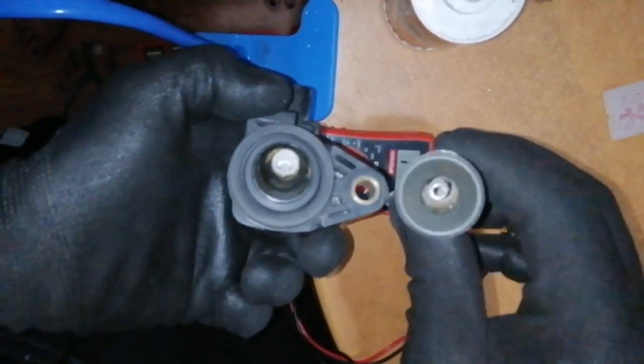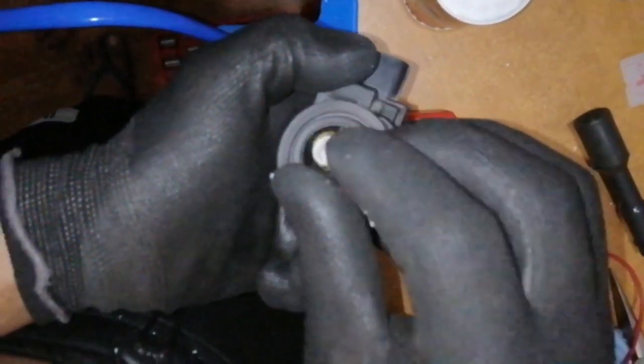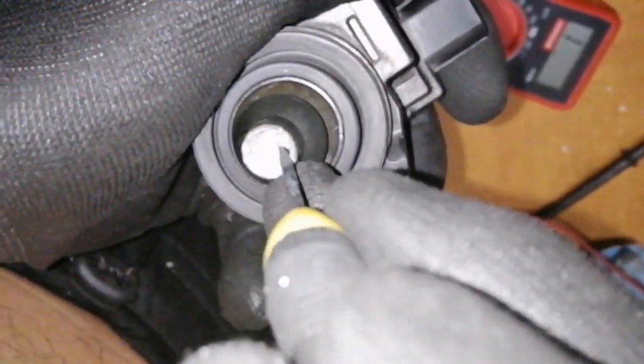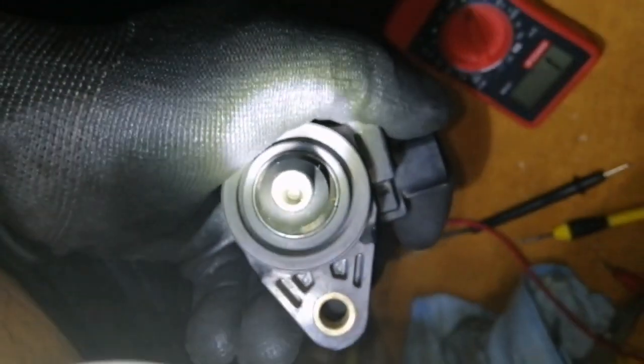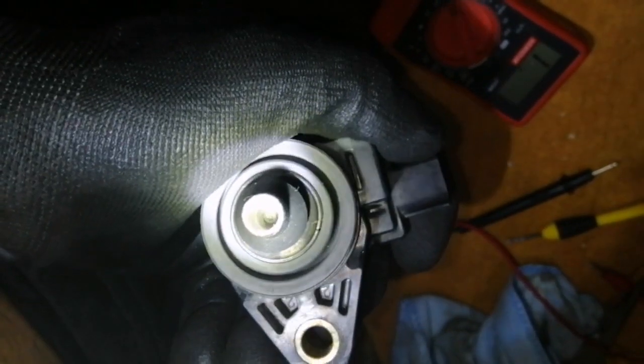And the next is cleaning the side of the coil pack. So basically what I'm doing here is scraping the white substance that sticks on the metal contact. The metal contact that interfaces with the other side of the spring. Note that the other side of the spring is connected to the resistor, and then the other side interfaces here. It's quite difficult. I apologize for that. It's quite difficult to see.